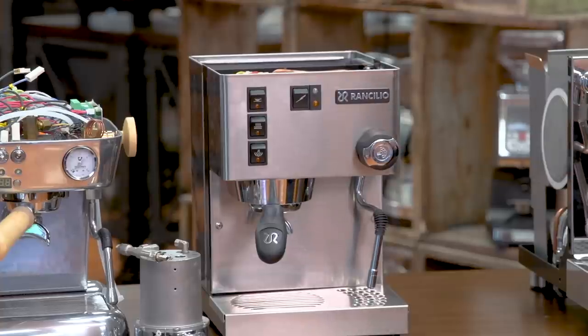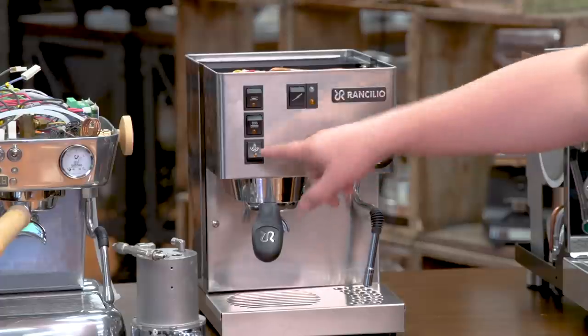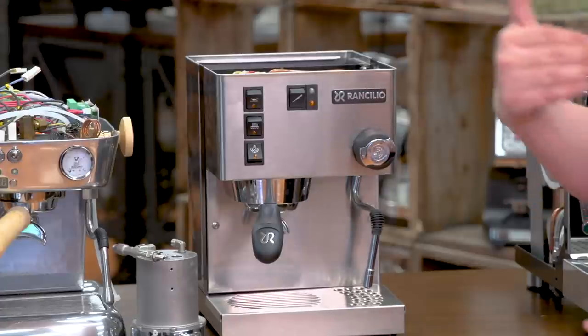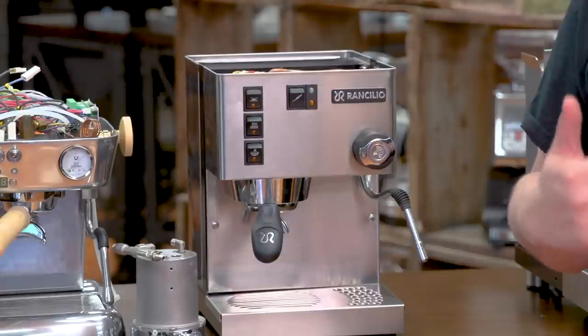A PID is a digital thermostat that helps you achieve a certain temperature inside your boiler. I believe that single boiler dual purpose setups are on their way out — I think a lot of these machines in the near future are going to be replaced with thermoblock systems because they're faster and they've gotten much better. For steaming with a single boiler machine, you can't steam and make espresso at the same time. Normally you flip a switch, like on the Rancilio Silvia, which bypasses one thermostat and moves to another, allowing the water to go to about 120 degrees and boil. You steam your milk, then turn the steam off and bring it back down to espresso temperature. It is a two-step process with a single boiler machine.